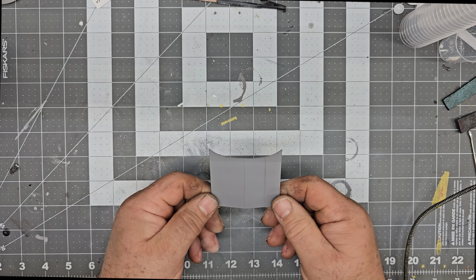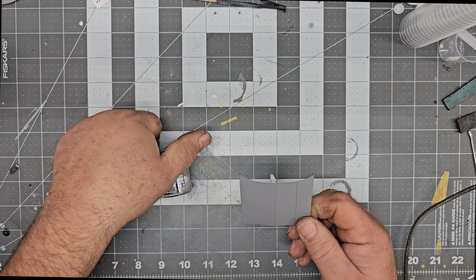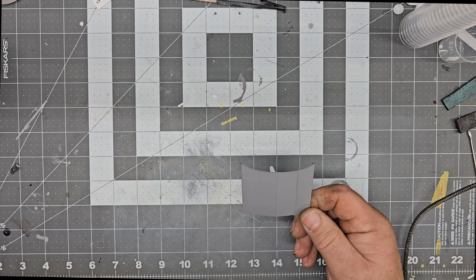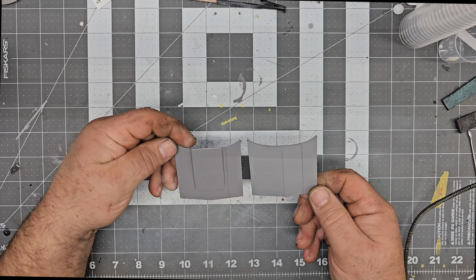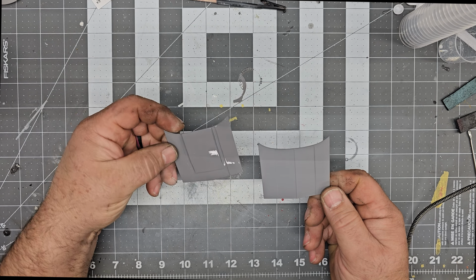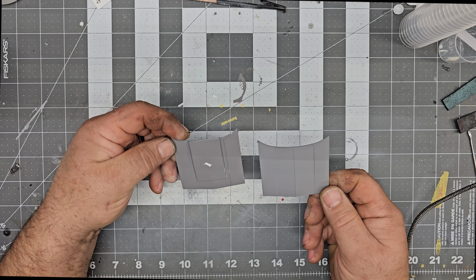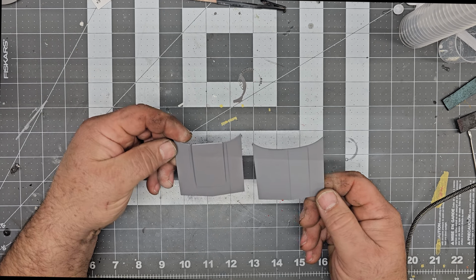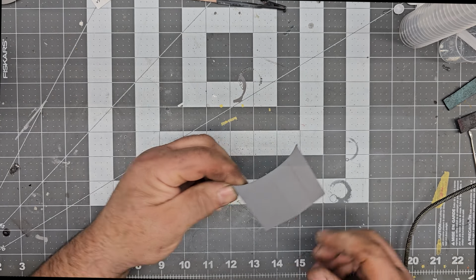So it's amazing, this isn't a shiny gray. I got it all over the bottle, a medium air gray, so it's going to be more of a flat color. But this is the miracle of clear. So this is what it's going to look like when it's done, just by putting clear coat on it. I should wet sand that down because there's a spot right there, but that's all right. Like I said, that sprayed out beautiful. That's just fresh out of the booth, off the gun. No sanding or nothing on that. So we're going to make this look like that, and hopefully it turns out just as nice with minimal work to it.